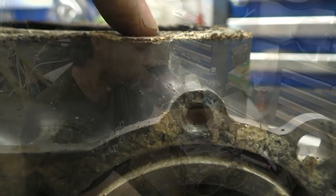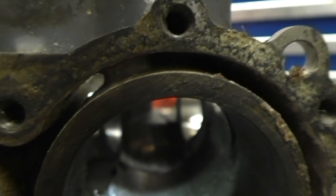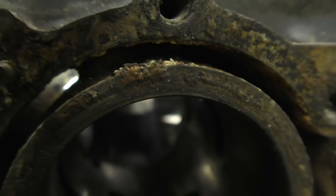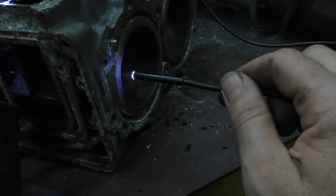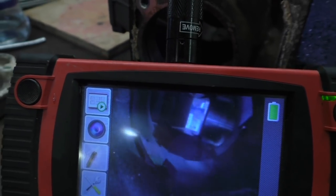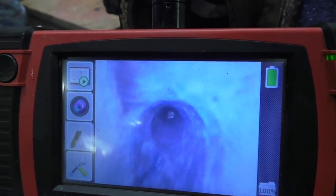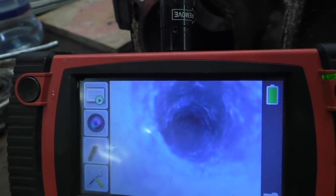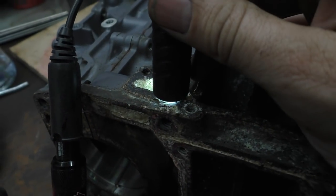I'll shine the light and show you how that works. We've got a hole on the top here that the cooling water gets to, and these are the water jackets around the pistons. If I shine the torch in that hole up there, you can see light shining down inside the water jackets. Then I'll take this little inspection camera and put it inside the water jacket of the bottom cylinder — you can see that's the cylinder wall and the water jacket. Going up inside this water jacket, there's a little passage, and we can see light shining through confirming they're directly connected.